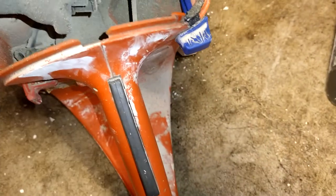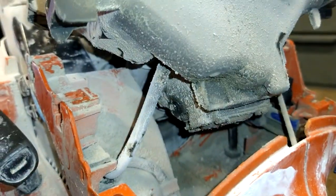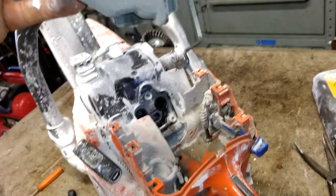If you look down in there, you grab it with needle nose and pull it straight up out. The hose already came off the primer ball — look, it just popped out. So it just clips right down into that. Then go ahead and pull the fuel line off of this side of the carburetor and that all comes right on out.